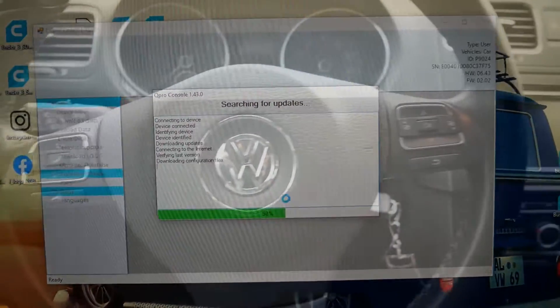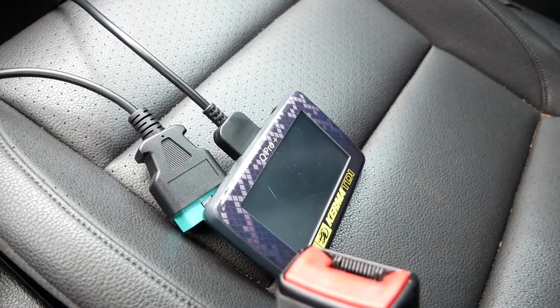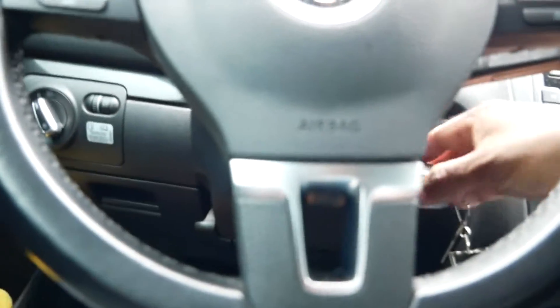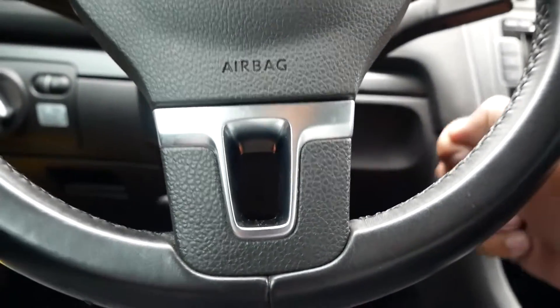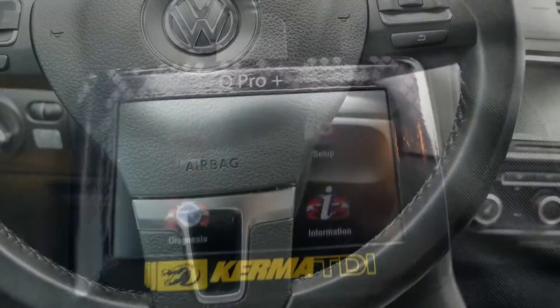So we are inside the wagon. Here's my Q-Pro and we're going to pull the baseline file — the stock file — from the car. To do so, your OBD2 port is down below. Plug in your Q-Pro, make sure the key is in the off position at the moment, plug it in and then put the car in the on position, making sure the car is not running — just on.